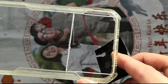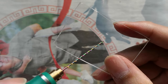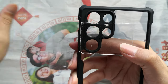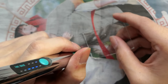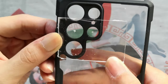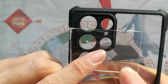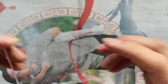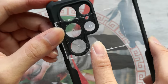I marked the 40x60mm rectangle on the iPhone TPU case first before cutting it up. I wasn't able to get a video of its extraction, unfortunately, but here's the cut piece. I etched marks for the pilot holes using a small screwdriver and lined the plate up to the phone case just to make sure everything's in order. All three pilot holes were then drilled using a 1mm bit. After drilling, I lined the plate up again to confirm all the holes were right. The pilot hole for the telelens turned out to be around half a millimeter off to the right, so I made sure to slowly steer it back to center as I went up in drill bit diameter.